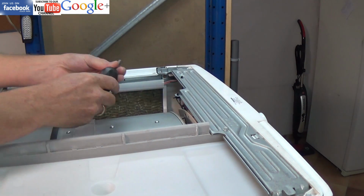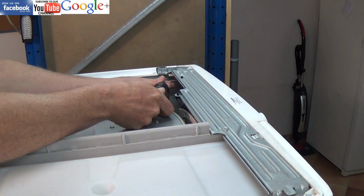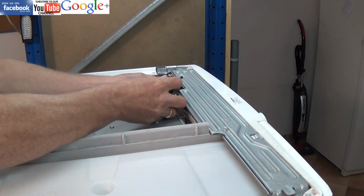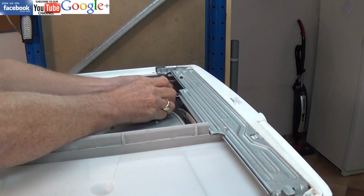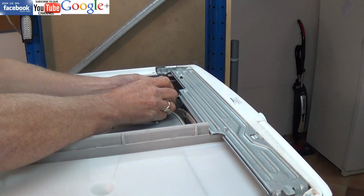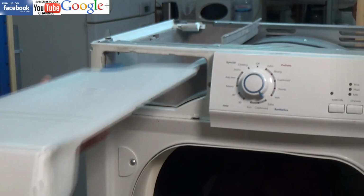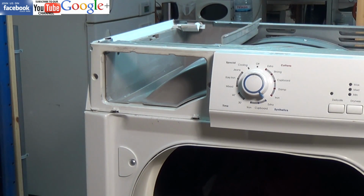And error 54, which we're working on here, is motor inoperational, and this could be due to an excessive load, low voltage, motor transmission system inoperative, capacitors or even possibly the motor, but not usually the circuit board.